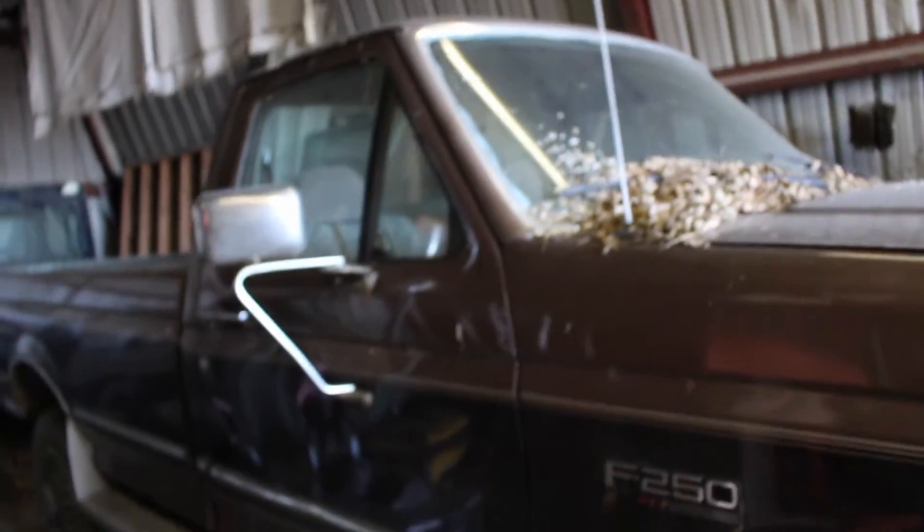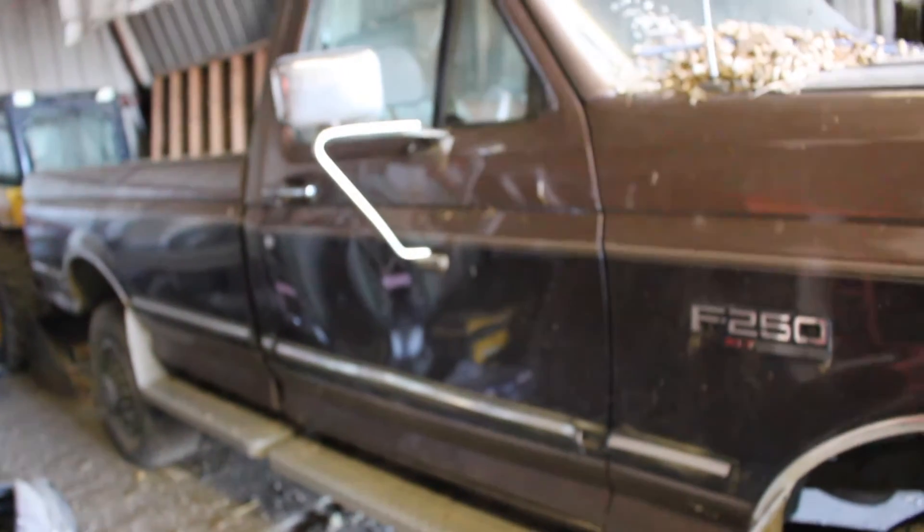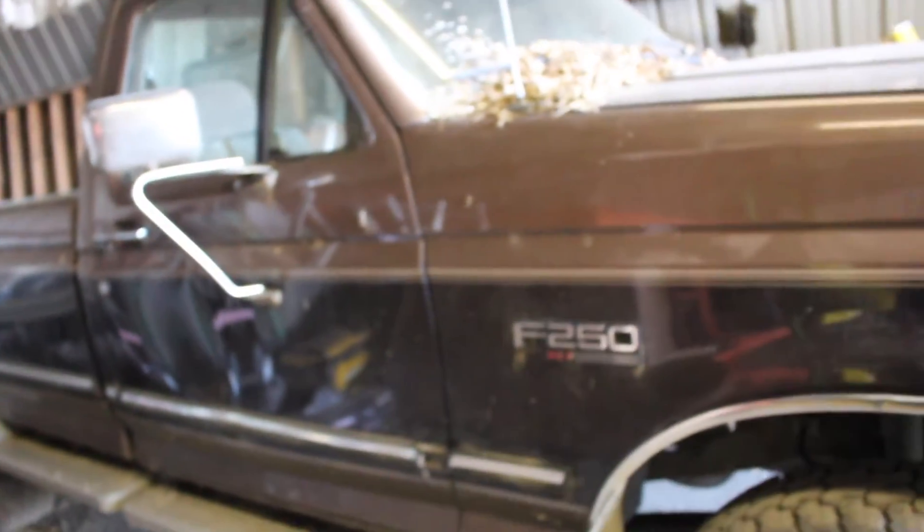The injection pump hasn't really been touched, so it could be that too. There's a little screen in there somebody said gets rusty. Also the mechanical fuel pump should be replaced - a seal goes out in there - and that hasn't been touched as far as I know. My dad claims there's been other things done to it. I think he said he did something with the fuel, so maybe the injection pump was replaced. We have done maintenance - it's not lack of maintenance.